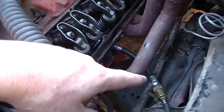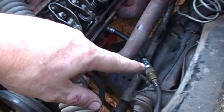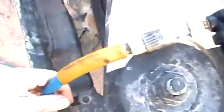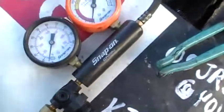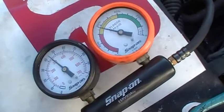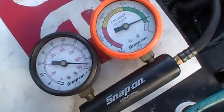It's different though — it has no one-way check valve to stop the air from leaking out. The air can go in and out because it needs to go back up the hose. I've got my air compressor connected, with the regulator turned all the way out. Now I'll just turn it all the way in until we get max pressure — there we go, 95 pounds.